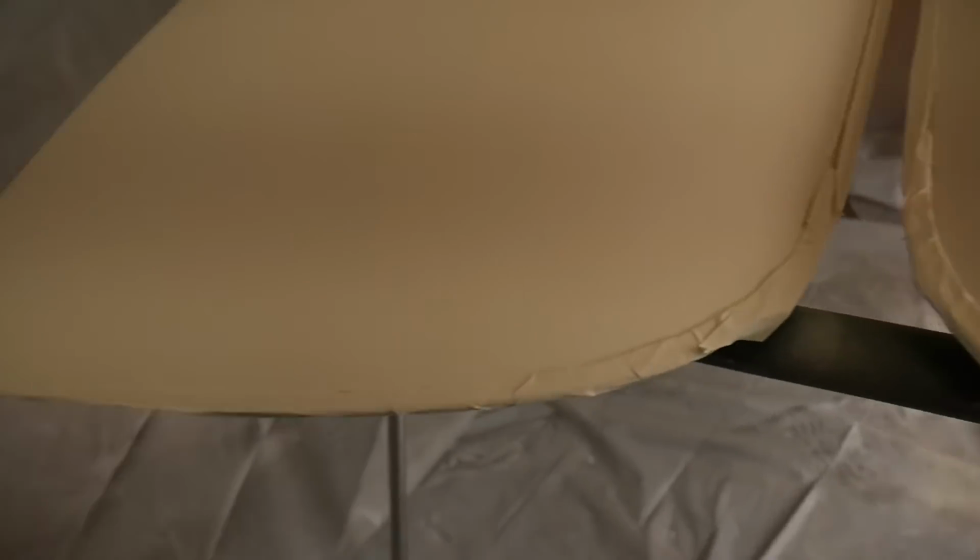I am so stoked about how this looks, and we are still going to be sanding this to get it as smooth as possible. I'm going to hop outside quick because it is still a little bit fumey in here. But on the can, it says to sand with 400 grit, which I thought was a little weird and seems a little bit coarse to then just throw the base coat on after that. So I'm going to look into that. It says you can wait like 3 to 4 hours and then sand it. I'm going to wait a little bit longer than that, but I'll probably catch you guys back a little bit later today and just begin sanding that down. I'm going to look online and see what people tend to do for the best results. So with that being said, I'll catch you guys back in a couple hours.